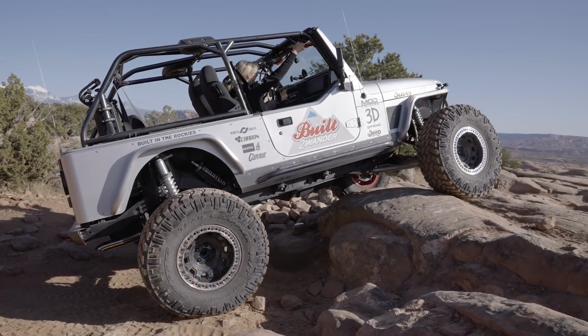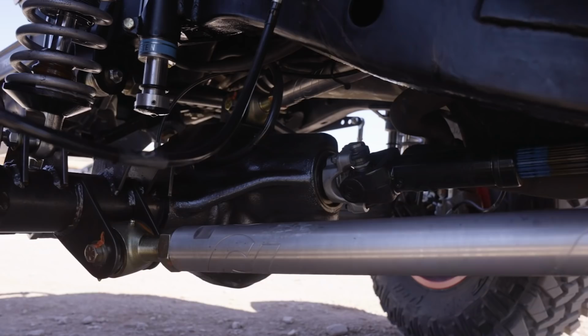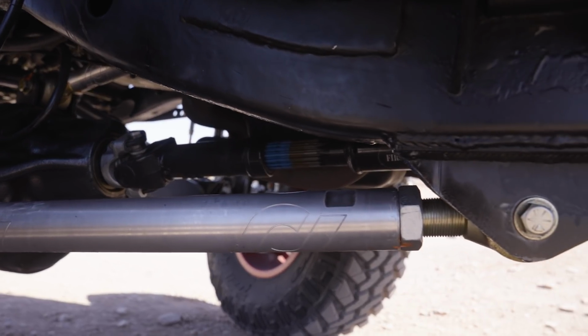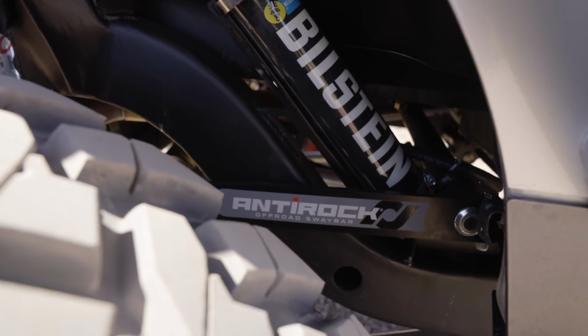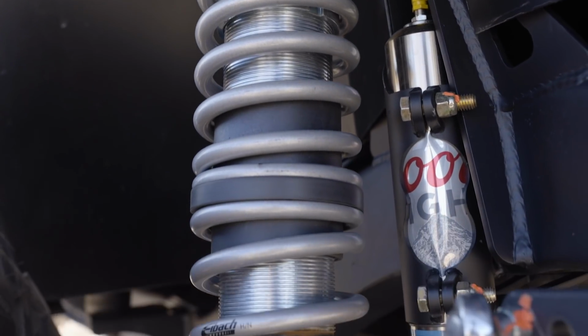Savvy's mid-arm suspension kit. It's a triangulated 4-link rear with a 3-link in the front. We leaned on Rock Jock 4x4 for aluminum control arms with their Johnny joints. We're also running their anti-rock sway bars front and rear to keep this thing nice and stable both on-road and off. So Matt Thompson did one-off coilover bracketry for this thing, both upper and lower shock mounts.